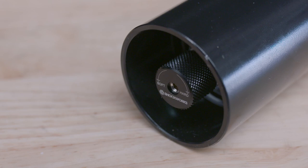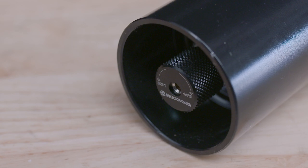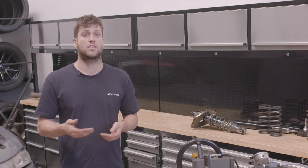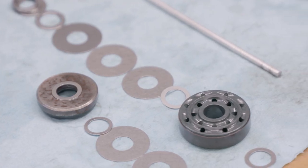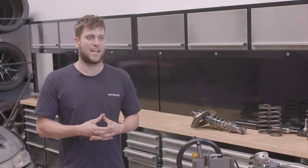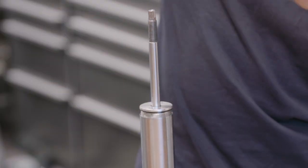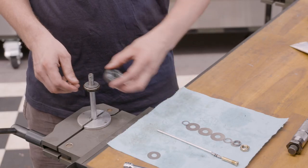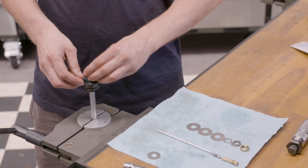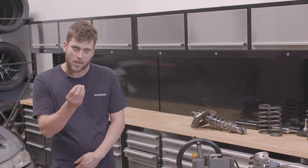For baseline coilovers with a single-way adjustment, all this is is an oil bypass where you can essentially bypass the damper oil to reduce the overall damping response of the shock. With certain brands they can offer a custom valving service for your tyre and application, because damper tuning goes much further than just choosing the right spring rate. Shockworks has almost 20 years of experience tuning for car companies globally, so we tend to be stricter on ride and comfort — we're used to having 60-year-old middle management telling us to take some of that ride texture out.